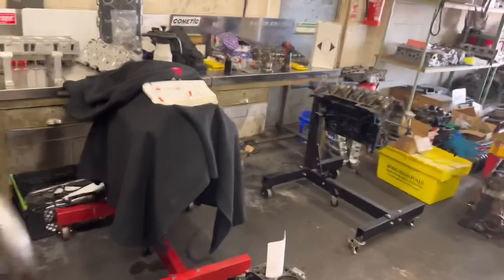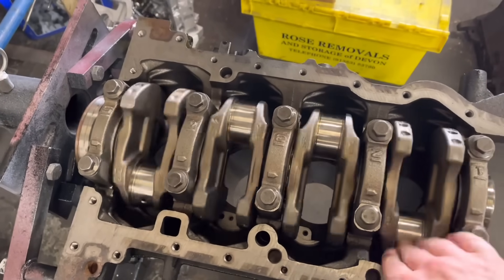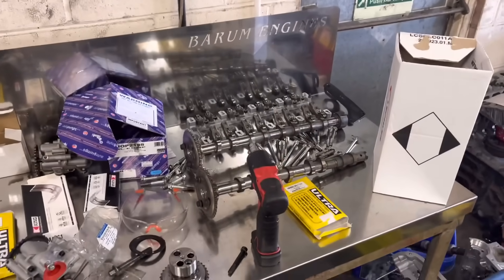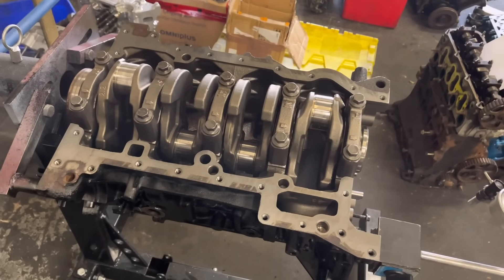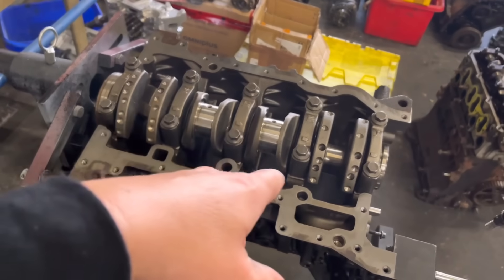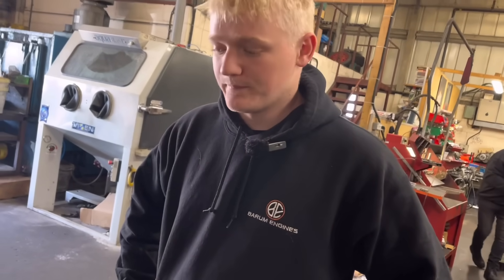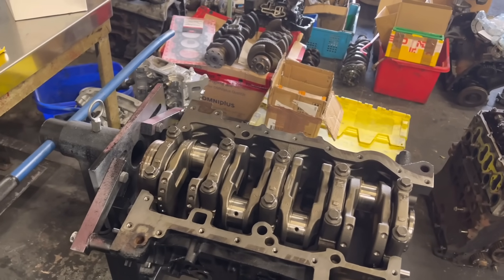You can see Isaac is over here - he's cleaned most of the bits. The crank's in. We just spin that crank and we've checked all the running clearances. This is only just a standard diesel build but he's still going through all the checks. So the head's all done, crank's all torqued up - I've only torqued it to about 20 foot pound at the minute just to check it spins right, then I'll torque it up properly. You can sometimes find with some of these blocks, before you do the last stage, the crank can lock solid. But that turns nice and freely, so with a bit of luck when you do the final stage it'll be all good.